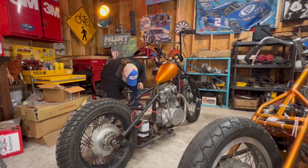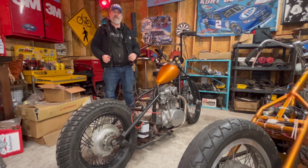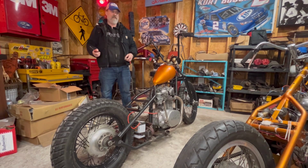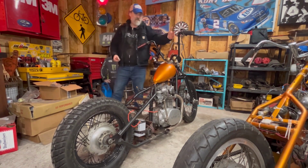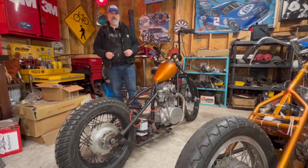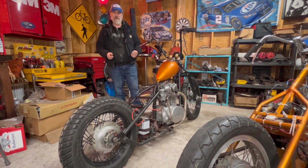All right, make good headway. Plugs and wires are done. Timing's done. Valves are done. Power's done. We're doing fuel. We even were able to salvage a throttle from an old motorcycle. I think it's go time, man. This is good. Hooking fuel up now, and then it's time to, I think, kick it over, right? Kick away.